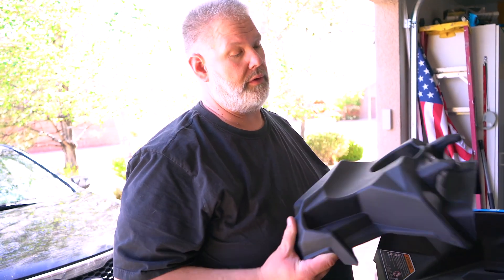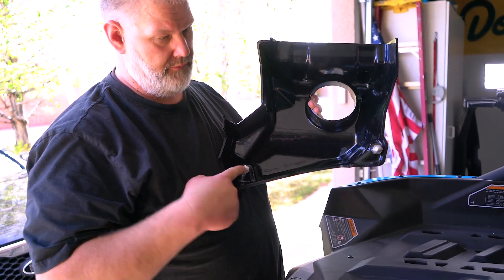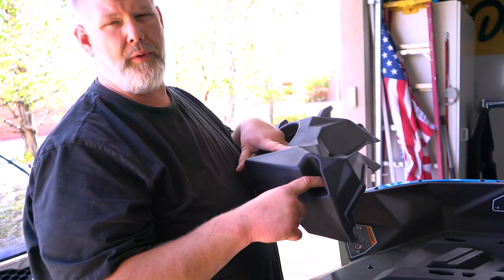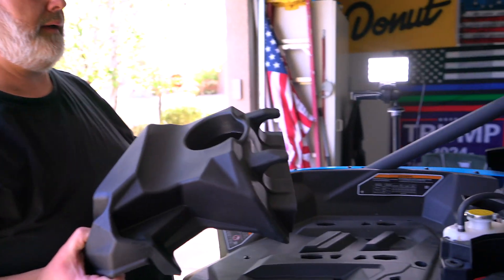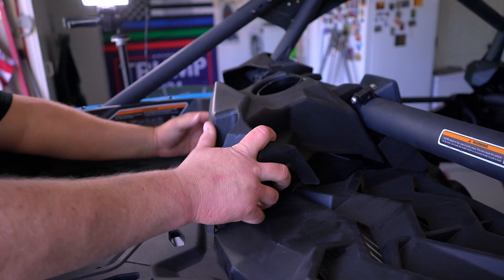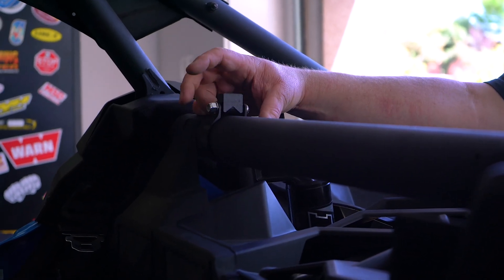Here is the new air box cover provided by S&B. You have to put these tabs on to lock them back into the grommets — you'll find these in a bag in the box. Just put them down, screw them on, use some blue Loctite, and then we can put this on. And the hose — there's the hose kind of lined up. Get this in place. So we already put the rings on, and as much as it doesn't look like it, the rings will fit.